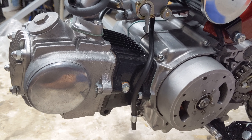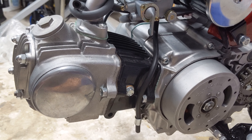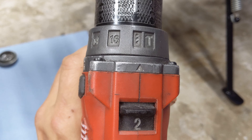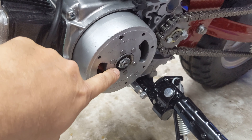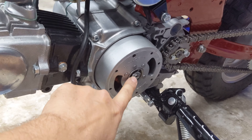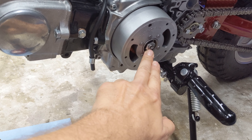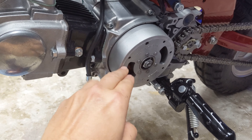I'll give you an example of how long it actually takes for oil pressure to redevelop at the top end. You're going to need a power drill that is a non-impact drill — make sure you're on the standard drill setting, not the hammer drill feature. The reason you want a standard drill and not an impactor is because the standard drill, with a properly torqued flywheel nut, doesn't have the power or speed to loosen the nut. What you're going to do is turn it counterclockwise — the same direction the engine runs when firing — to drive the crankshaft and move your oil pump, since it's all on a cam chain system with a wheel that drives the oil pump.